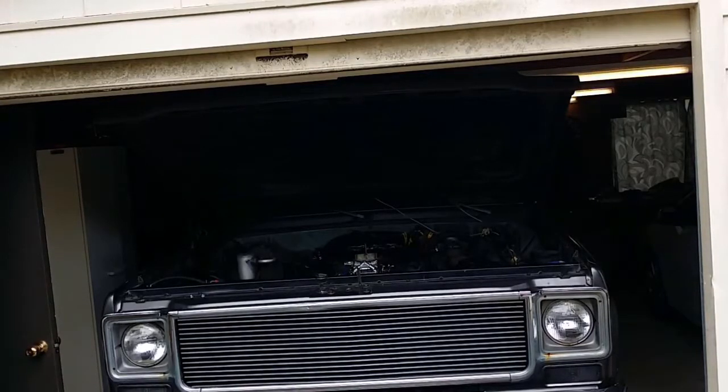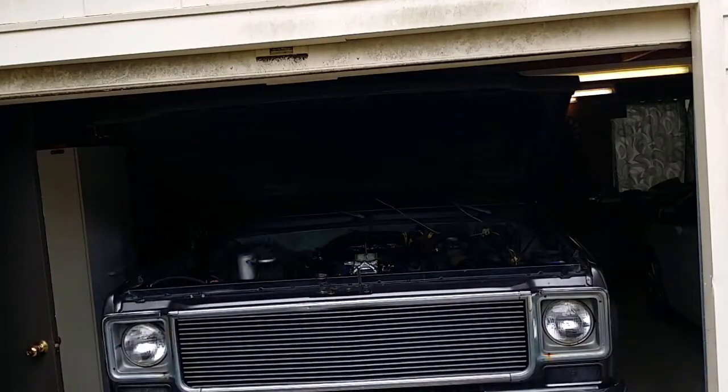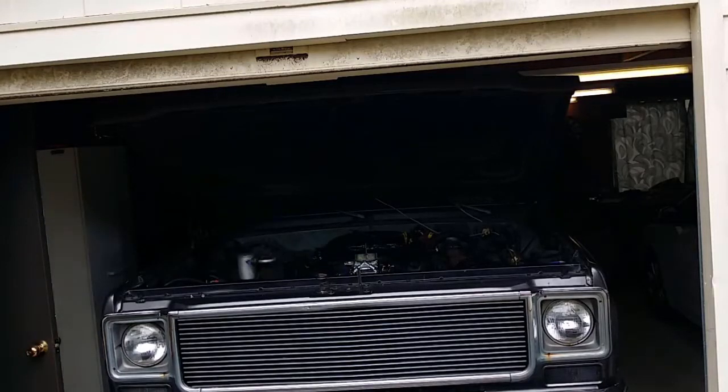Just as I got under there to tap the motor, the starter stopped. Alright, take two. Okay, that made no difference. The next thing I'll do is put the shims or the washers underneath the starter. Okay, so you may be able to see that there's actually two washers there, and I'm going to try putting one of them up in between the engine block and the starter.